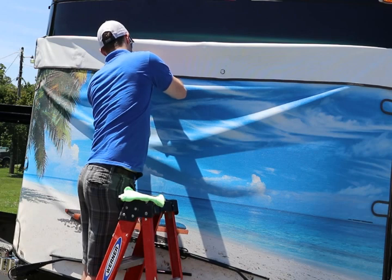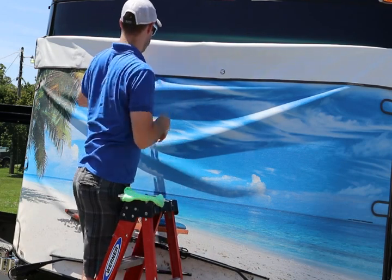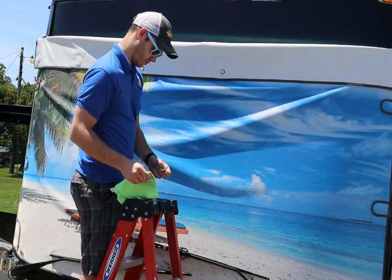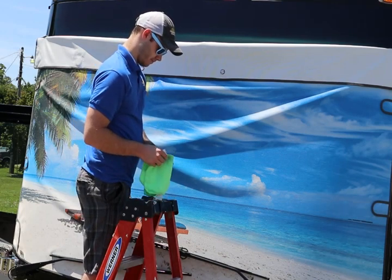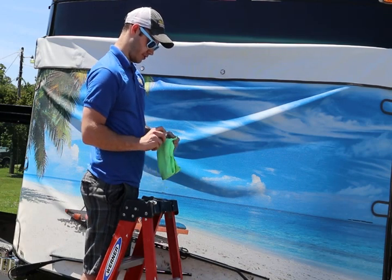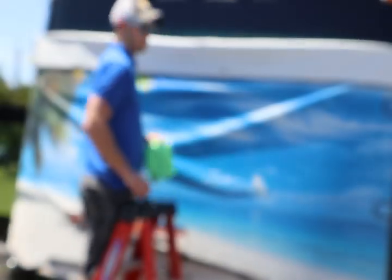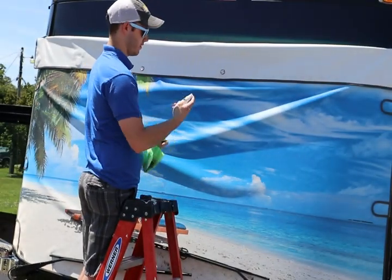A couple of tips: if when installing your shade from the ground with the rods the fabric seems like it's dragging against the windshield, it's a good idea to clean your glass with light pressure using 4-0 steel wool and foaming glass cleaner. We also suggest using foaming Rain-X glass cleaner — but not in the pocket areas. This just helps the shade slide up the glass when getting ready to install it.